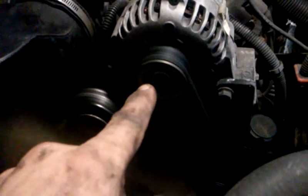As you can hear, she's running. I had to put the air intake and lock it back in there for a moment, but we know that the little chirping noise is the alternator bearing — that's the only thing that needs fixing, it's not even really that loud right now. We got her running and I don't see any leaks anywhere. You can hear the valves tapping with the lifters, so I don't see any problems down there — no water leaking, nothing like that. Everything looks good.